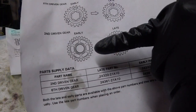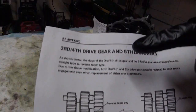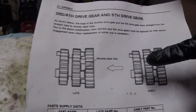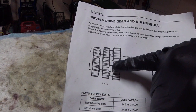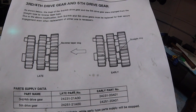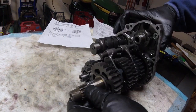Even though to me these look almost identical, this diagram was a little clearer. You can see here in the early style — third, fourth, fifth, and sixth gear — the dogs mesh together with the teeth almost in parallel, whereas in the new style they have a reverse taper. As you apply torque in the old style, there's a risk that unless the dogs are strong enough, the gears will separate, fall out of sync, hit each other, and destroy the gearbox.